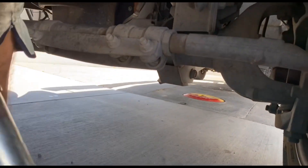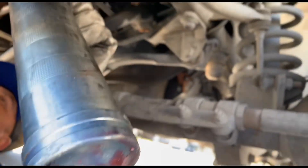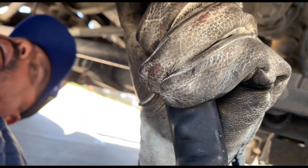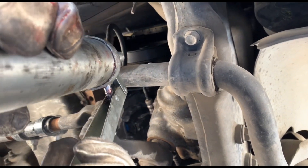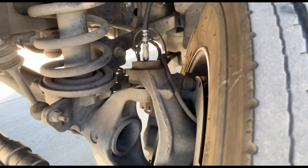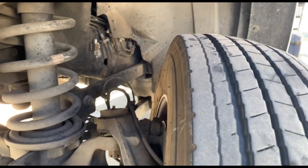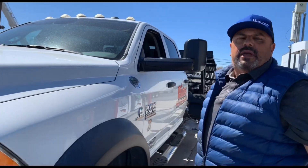And of course, this is on the truck. I like to do these every 7,000 to about 8,000 miles. And as you saw, he did about two pumps on the truck on that fitting. So that's the top. Now we're going to do the driver's side, then we're going to do the passenger's side. Turn the wheel to the right, and then release that other side.